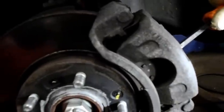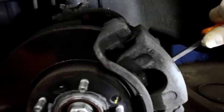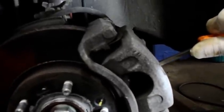What we're going to do first is take our pry bar and come in to the back of the rotor and pry just a little bit to get the piston to push back in just a little bit, so we can check our slide pins to make sure they're working properly. You just keep constant pressure on it and it slowly pushes all the way back in. Then you're going to check your slide pins up here to make sure they slide correctly — both top and bottom — and they're sliding just the way they're supposed to.